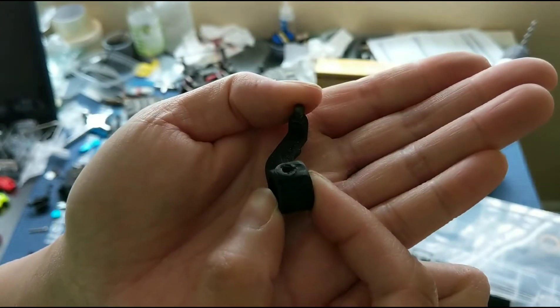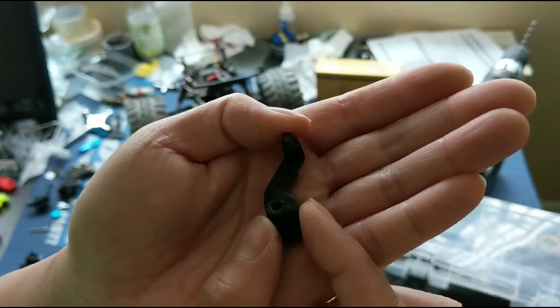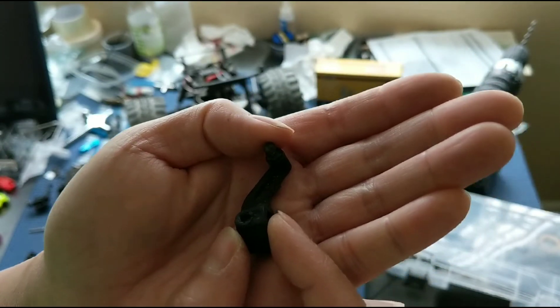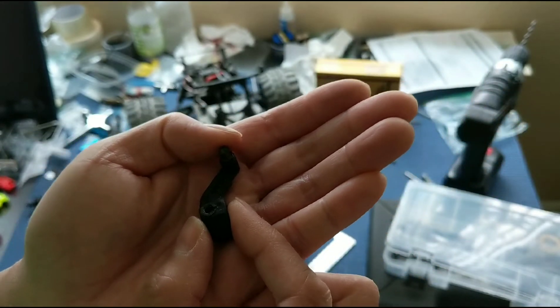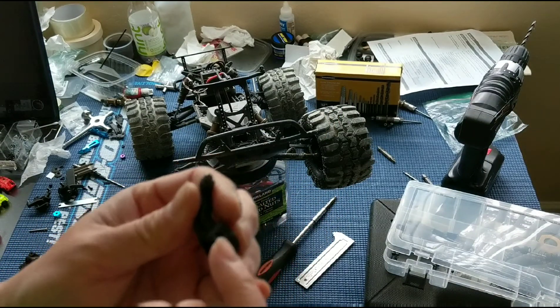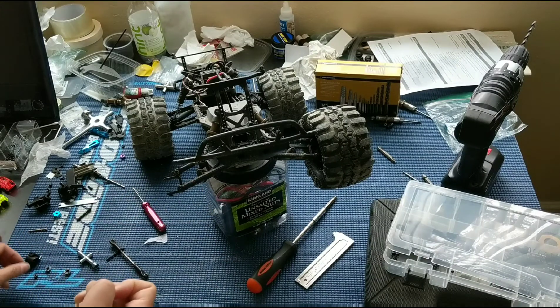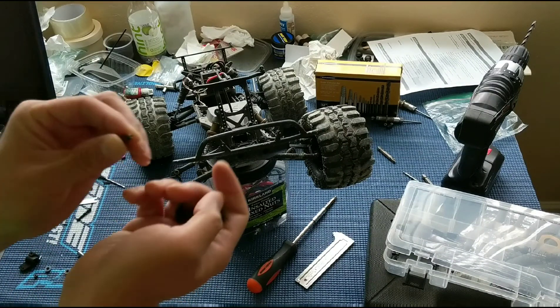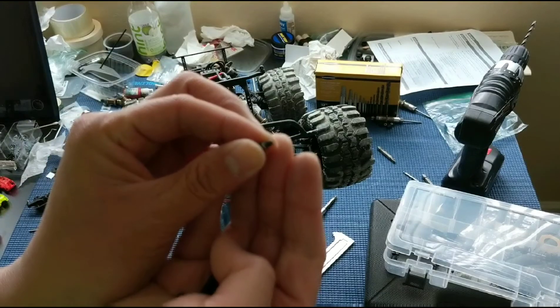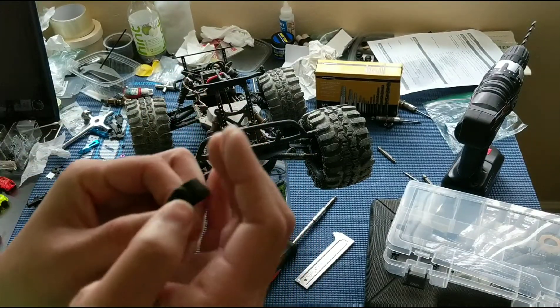You can see that. Even if we used super glue, it probably wouldn't hold too well over time, and we'd lose yet another shoulder screw or a regular screw. Measuring the depth of this, it was three millimeters, which is the exact same length of the thread on the shoulder screws. So again, not a huge amount of engagement there.